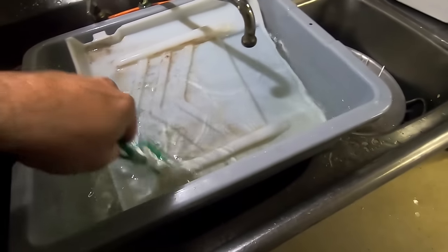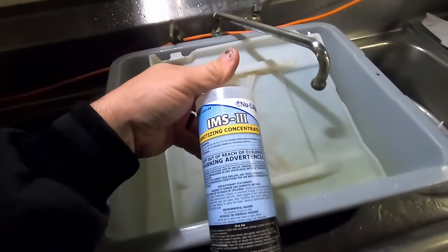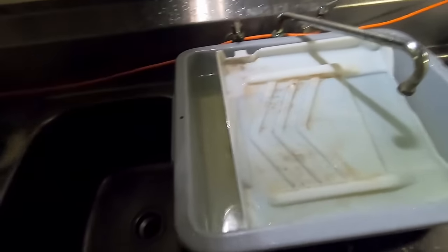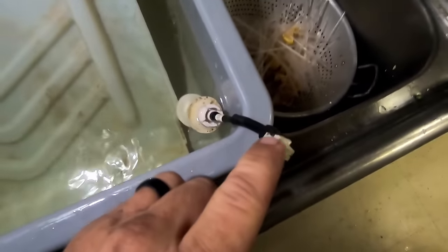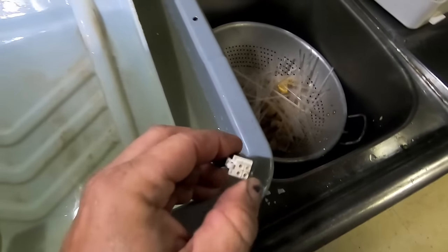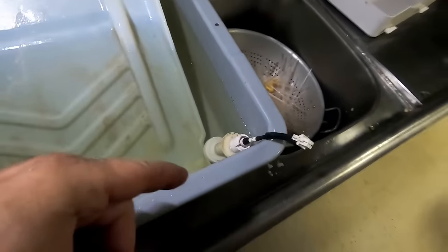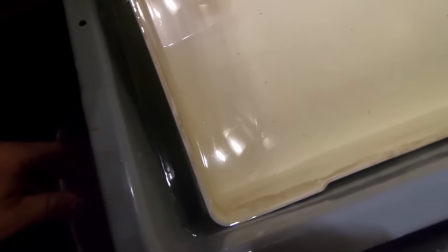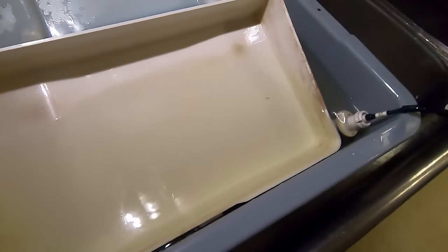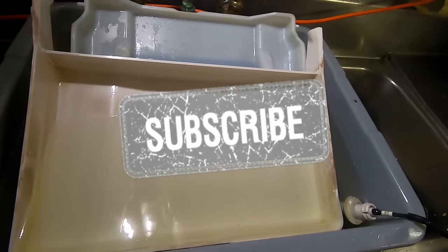I've had machines where I've just said there's nothing more I can do because it's just completely ruined — it tends to eat into the material and you just can't get it out. As a last-ditch effort, I'm basically trying to use my fancy utensils here, let it soak, and go in there to see if we can get some of it off. But chances are it's probably not going to do any good. When it's all said and done, I'll run the IMS-3 concentrate disinfectant through the machine. Make sure you don't get this plug in there because if you do, you'll corrode those connections when electricity flows through. It's not attacking it as aggressively as I'd normally see, but there's probably a good three gallons or better of water in there.